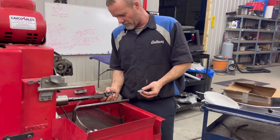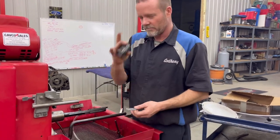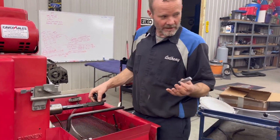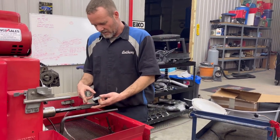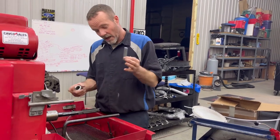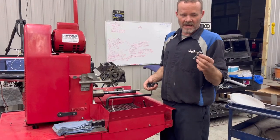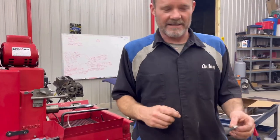Because this truing stone, this sleeve, will go in there and just make it flat, right? So I'm debating right now. I'm going to go read the book and double check again and make sure that I need to have a new shoe with a new stone. Otherwise, like I said, I'm just going to go ahead and put the finish shoe in. That way I can finish these. I want to see how long it takes for the finish stones to cut all of that out, two sides. That's what we're doing.